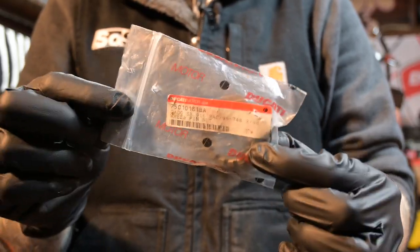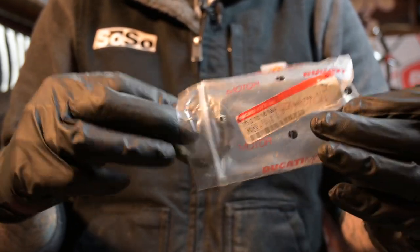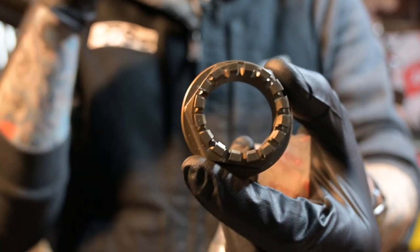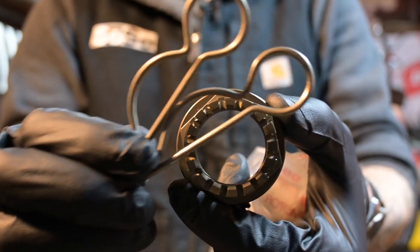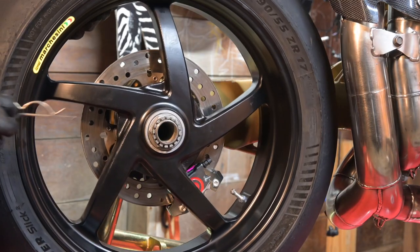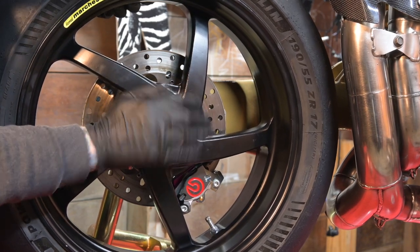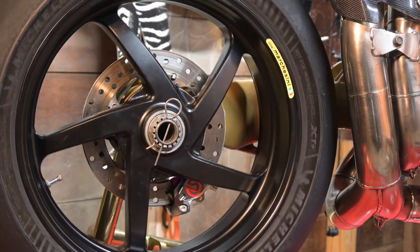Because I do not know when to leave well enough alone, we have this rarity. This is originally meant for the 916 Racing or the 748R, and as such is very hard to find. This is a lightweight wheel nut, and the crenellations on the top are pretty far apart because it is meant to be used in conjunction with these tools. The nut on the right is meant for the sprocket side, which I found out later. But the pin goes right through there and the clip side clips into the little groove. That looks so much cooler than the stock clip.